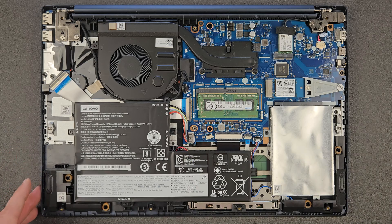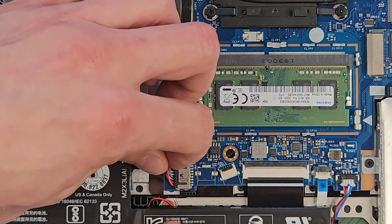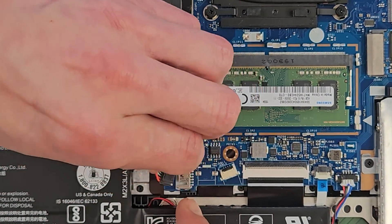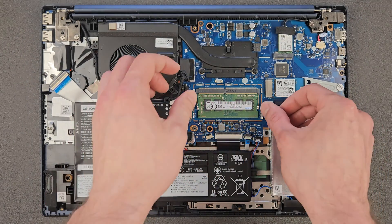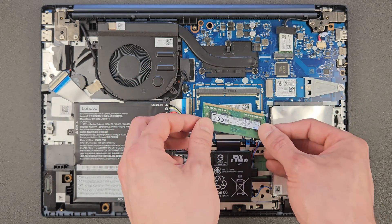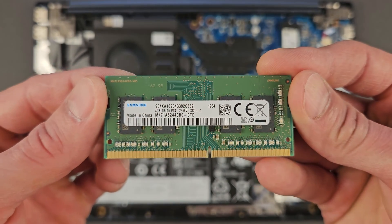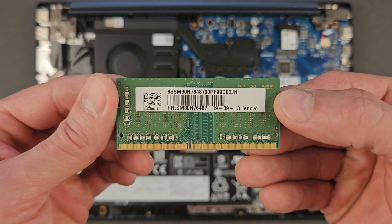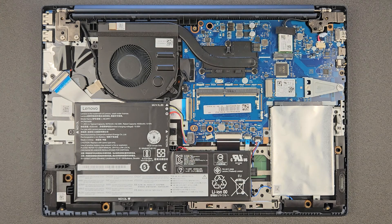Okay, we're nearly ready to upgrade. All you have to do now is disconnect the battery — just so you don't short anything on the motherboard while removing the RAM or solid state drive. For safety, I left it connected and nothing happened either, but I do recommend disconnecting it if you can. That's your RAM — what's in it at the moment is four gigabytes, and as I mentioned, four gigs are on the board as well, so in total there's eight gigs right now.